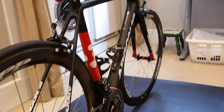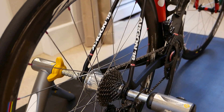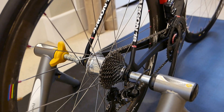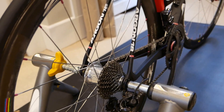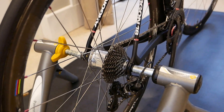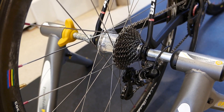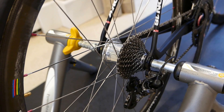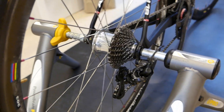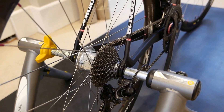The last thing for the rear derailleur is to go into ride settings — just hold one of the mode buttons down for six seconds, then do a bit of fine-tuning if you've got issues. Rather than running through the zero settings multiple times when you can't get it dialed — because it's a bit of a hit-and-miss thing — try to fine-tune it in ride settings. Just remember that your ride setting does get erased if you zero-set. I did the zero setting three times and never got it absolutely perfect for all combinations of big and small ring across the full gear range. I fine-tuned it just ever-so-slightly with the ride settings and then it was dialed. Definitely don't panic if you can't get it quite right with the zero settings alone.